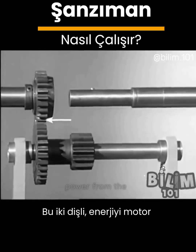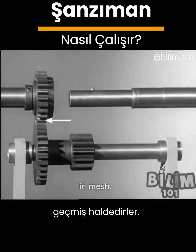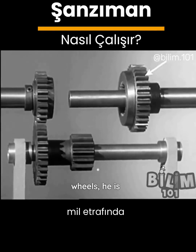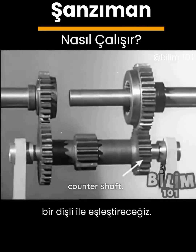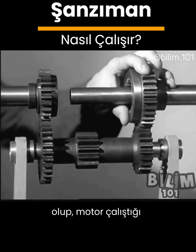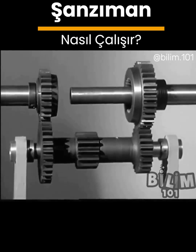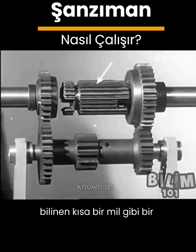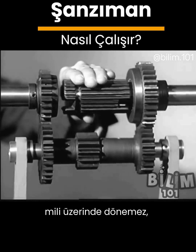These two gears carry the power from the engine shaft to the counter shaft and are always connected or in mesh. This gear on the drive shaft going to the wheels is free to turn around the shaft. We'll put it in mesh with another gear on the counter shaft. These gears are always in mesh and keep turning while the engine is running. To switch from one set of gears to another, our transmission needs a short shaft known as a clutch sleeve. It cannot turn on the drive shaft but it is free to slide back and forth.